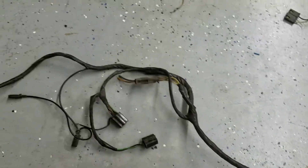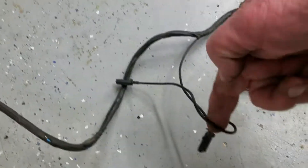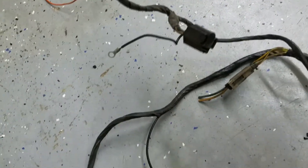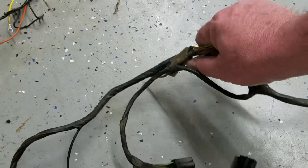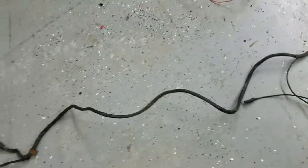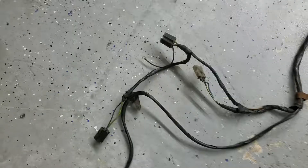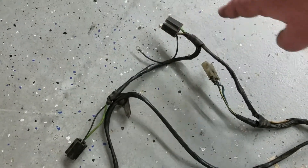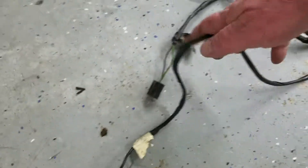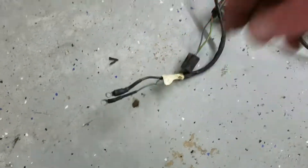Back in the engine compartment — this lead continues, this is all for the headlights. These leads here are for the horns. This is for the driver's side headlights — low beam and bright. Parking light. It still has the end on it; I just have to plug it in. This goes down past your side lights to the ground. This part of the harness goes all the way back to the generator. And that's the complete harness.